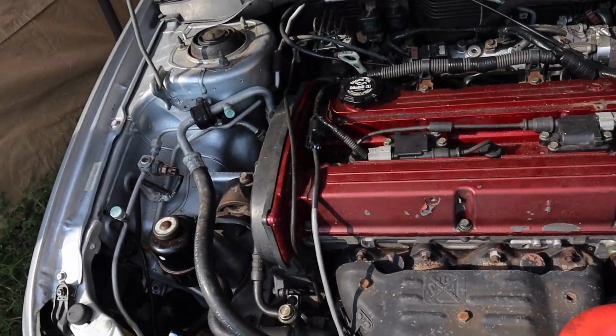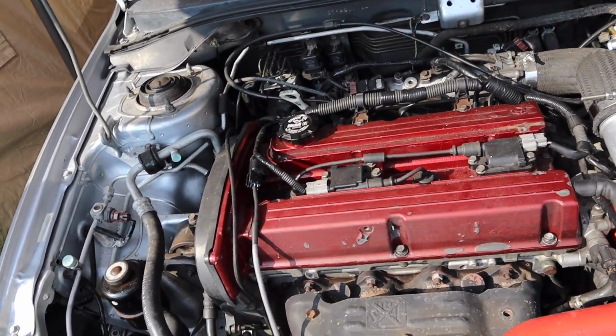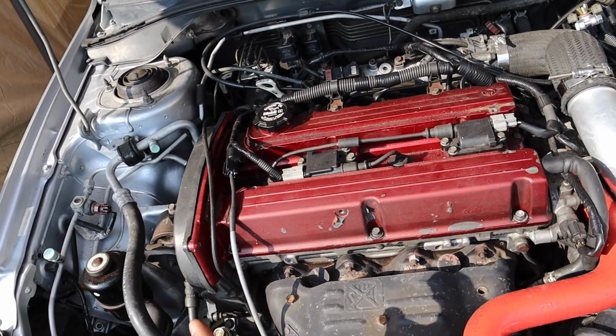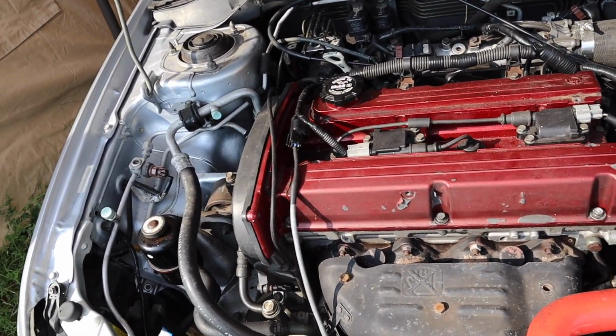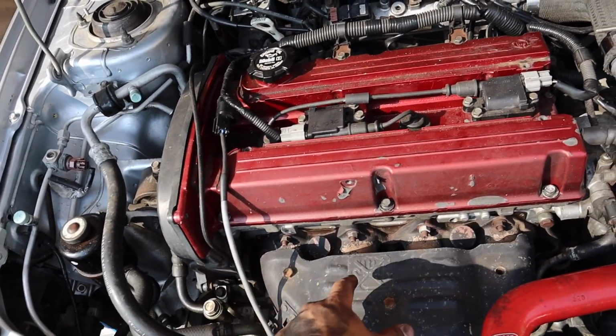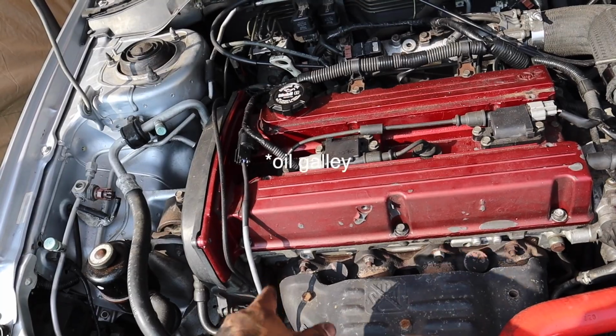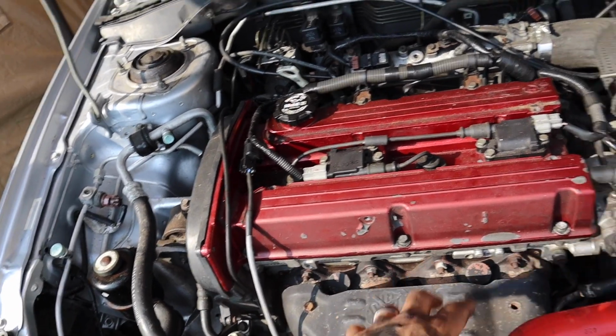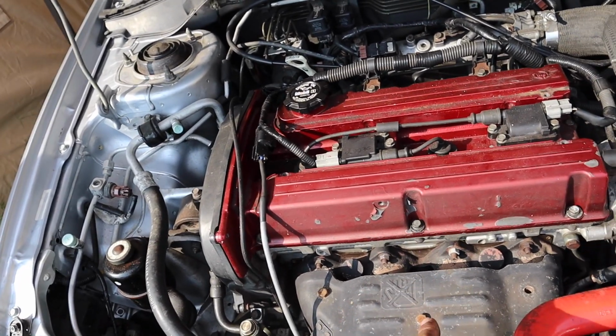I need to look over a couple of things, like why at the front of the engine, when we have the car running, it smokes. It's like something is burning around the exhaust manifold. I feel confident it has to do with the studs on the bottom section that hold on the manifold. They have port galley. If the studs are not sealed, it's technically leaking and it's going to burn off the manifold, but we'll save that for next time.